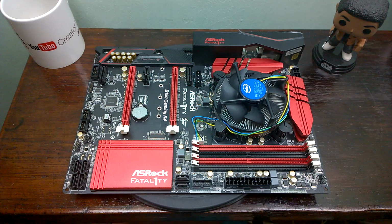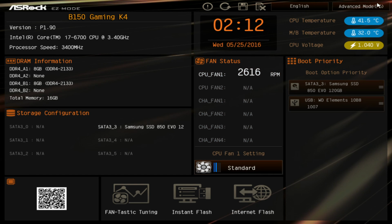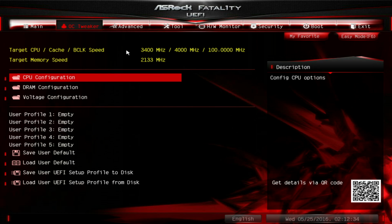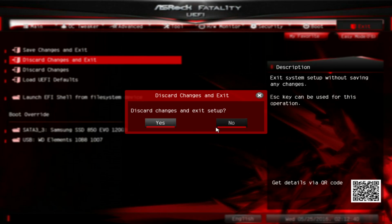Well, it actually does perform great. There is no tinkering available. You can't overclock your CPU. And this non-hyper variant, there is a hyper variant of this same board, can't overclock the RAM. This doesn't have that RAM overclocking. This tops out at 2133 megahertz, and that's pretty good already. Actually, the benchmarks are pretty much the same.